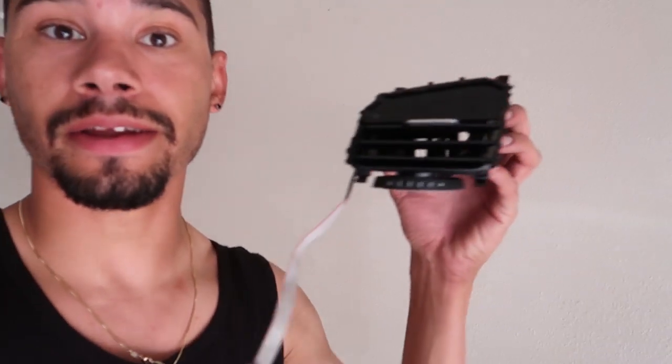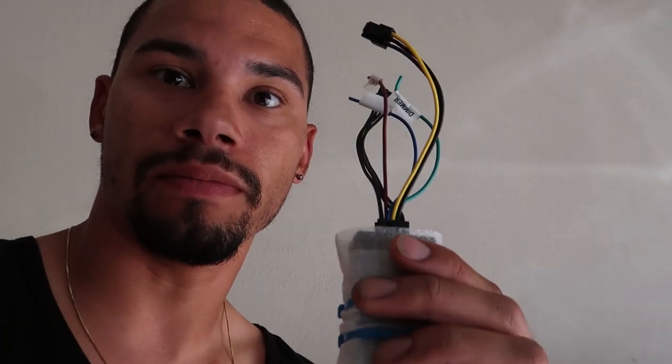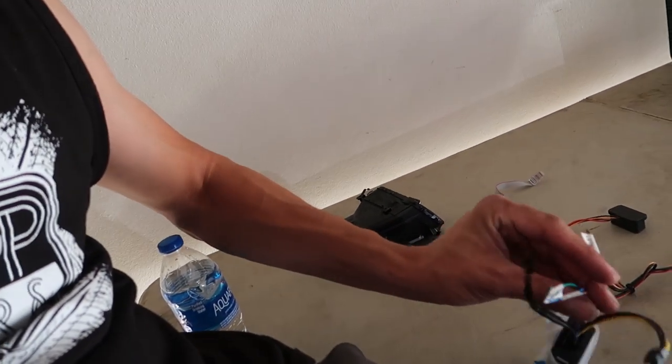We are back, days later — I got a new P3 gauge, shout out to my boy Alan Guzman. This is actually an upgrade from my current one because that was the v1 and this is the v3. It shows AFR and does things like zero to 60, 60 to 100, and other stuff — besides AFR that's nice. The connectors are a little different, a little more compact on the wiring. I'm going to put connectors on the ends to run it and I might use a different fuse. This time I'm going to have the battery terminal off — I think I may have short-circuited it somehow when I plugged it into the fuse. I'll pull the old one out and put this new one in.